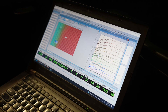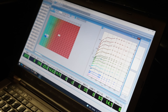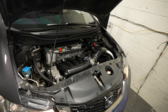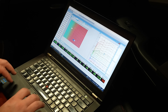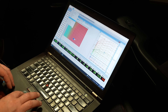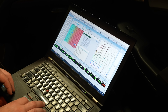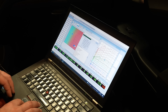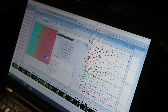As Nick progresses through the tune you can see the fuel table getting sorted one box at a time. You can hear the distinct growl from the new RBC manifold as he works through it. Nick is only revving the car out to whatever RPM he's currently tuning, and you can see he's making 162 wheel horsepower at 5,500 RPM with non-VTEC done. Now he's going to turn VTEC on and switch the live tuning tables from low cam angle to high cam angle, low fuel to high fuel, and low ignition to high ignition.